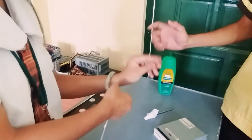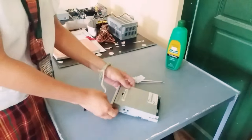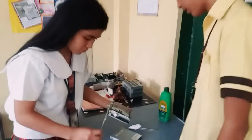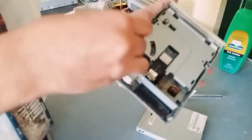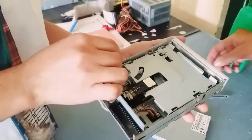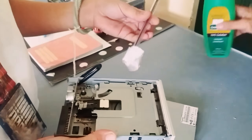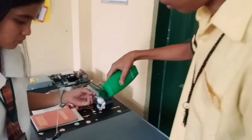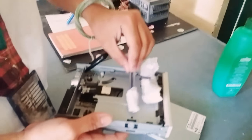Then, let's go on to the cleaning. First, you need to remove the outer case of the Floppy disk drive. Connect the improvised anti-static wrist strap. Then, get the swab and place alcohol on it. Don't use water because the Floppy disk drive might be damaged. Then clean the parts where there is dirt.